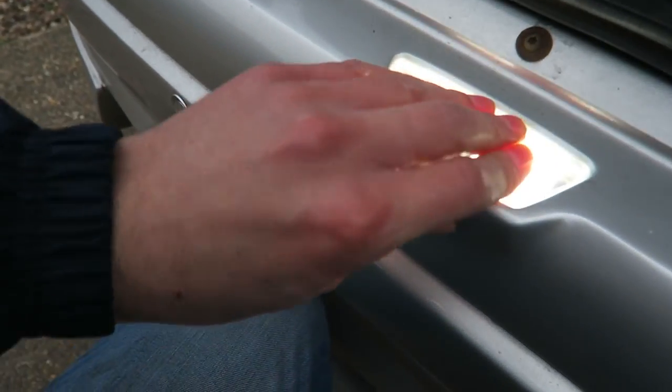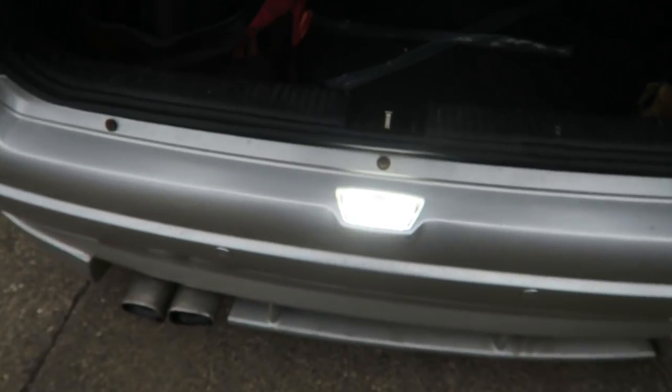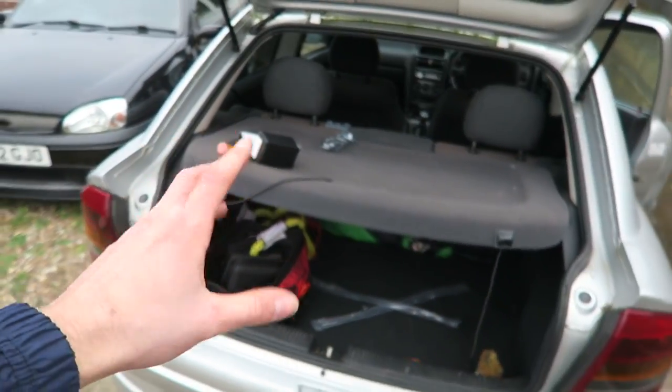There we go — a super quick install, like 30 seconds' worth. I'll just turn my lights off so the buzzer stops. Right, so that is going to wrap up today's video. I know it wasn't overly exciting, but these are the bits I got for Christmas and I wanted to get them installed. Pretty successful day: the bonnet struts, although a little bit fiddly and the instructions were awful because they're in Dutch, I managed to get them fitted. The boot struts got fitted and the boot now opens a lot easier. And the number plate light — we switched out the halogen for a nice LED one, so that should light up the number plate nicely and white.